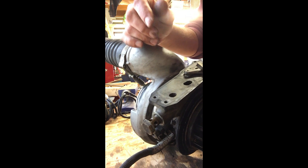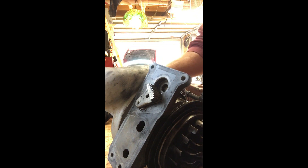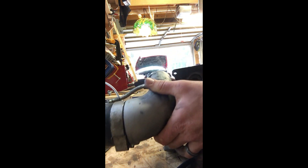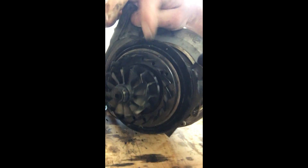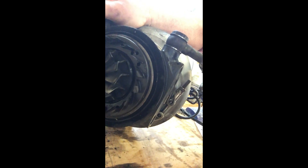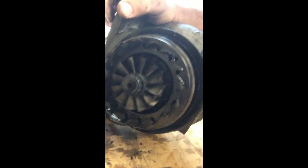We'll put it back on and test it before we fill this thing up with coolant and see if it'll work. I hope that was helpful to somebody. Here's a quick overview: this is a standard HE351VE and it does have a Batmobile installed. This is the VG nozzle, which causes all the problems — it slides in and out, run by an electrical actuator commanded by the ECM. This ring here is a sealing ring; once it's on the exhaust housing, it holds it in place so it can't move, and it seals exhaust from getting inside back behind this thing.